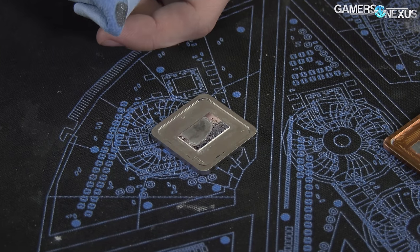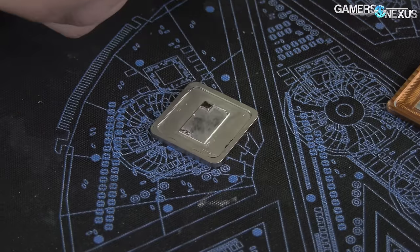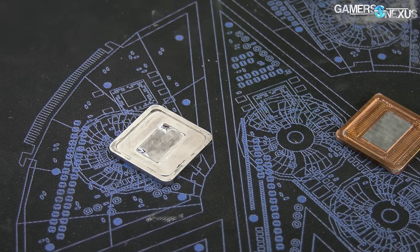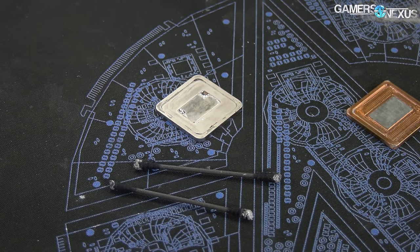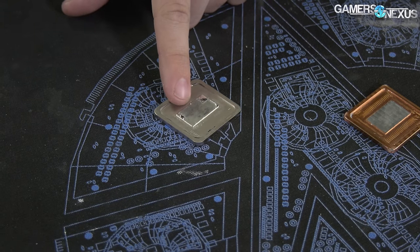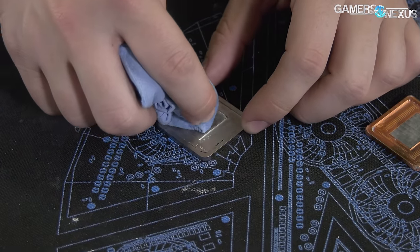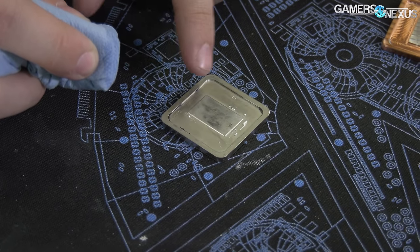You have to be careful about dropping any liquid metal onto small surface mount devices and potentially causing shorts. Sometimes the rubbing alcohol and towel doesn't work so well — for example, if your liquid metal has been sitting there a long time. In that case, move on to a clean Q-tip dunked in rubbing alcohol, which is great for getting the more stuck pieces. You'll see there are still some black marks left, but some of that is going to be permanent. It doesn't impact thermal performance in any meaningful way — we've tested it.